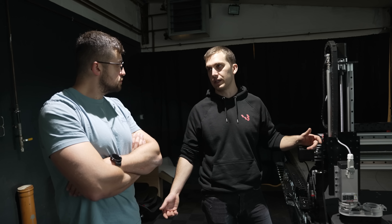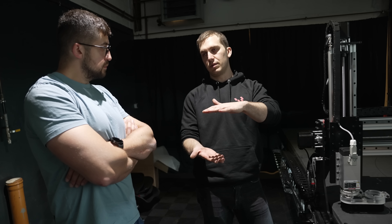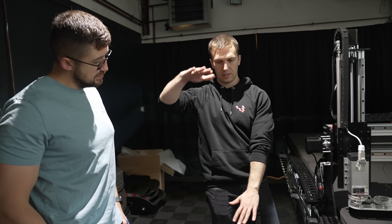Maybe if we want to do one-offs like body kits we can do that. Of course, for example, a fender is not only 200 millimeters — maybe it's a bit more, maybe a bit less. But you can stack them, you can glue them together and make a deeper mold.